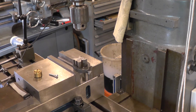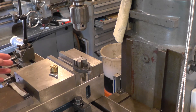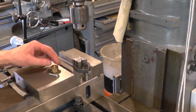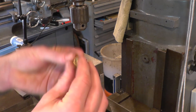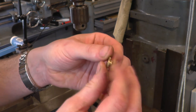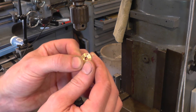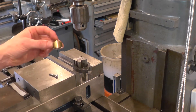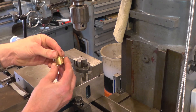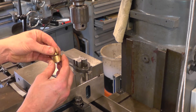My friend Martin has been testing the new damper rods and assemblies that I made, and definitely the rebound damping improvement is working very well. But we haven't got the compression damping dialed in with the oil weights that we want to use. This little top hat is the compression valve plate, and the little hole towards the edge is the low speed — as in low suspension deflection velocity — orifice. It's spring-loaded onto the top of the emulator unit, and at higher deflection velocities the valve gets pushed open against the spring to give you a softer damping rate.